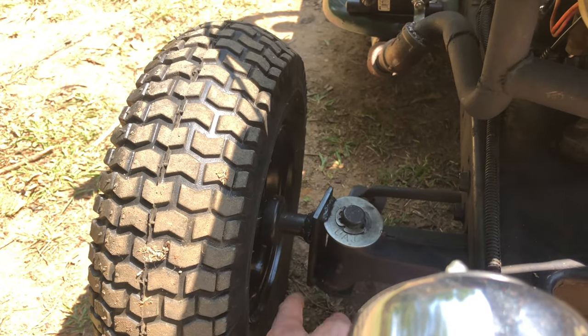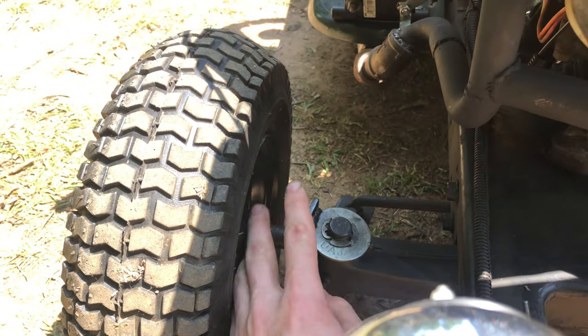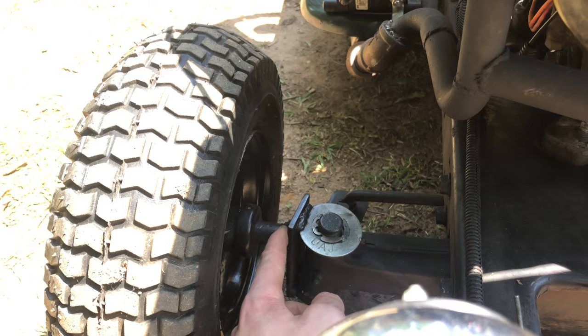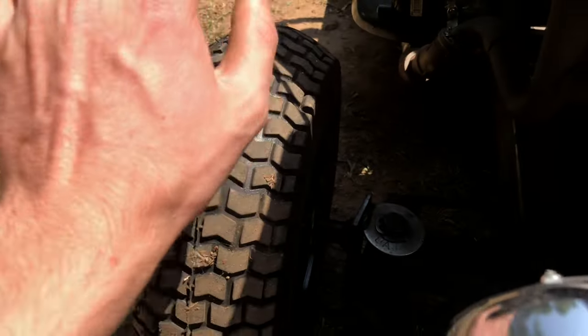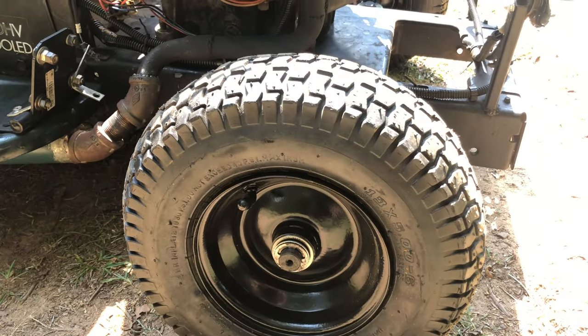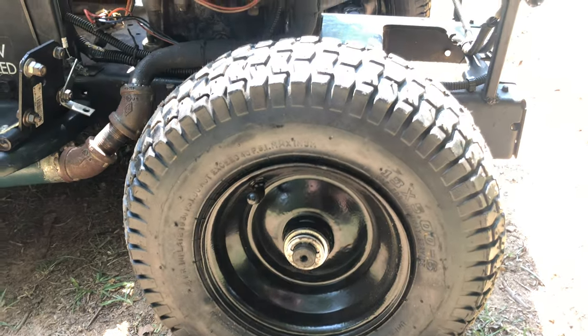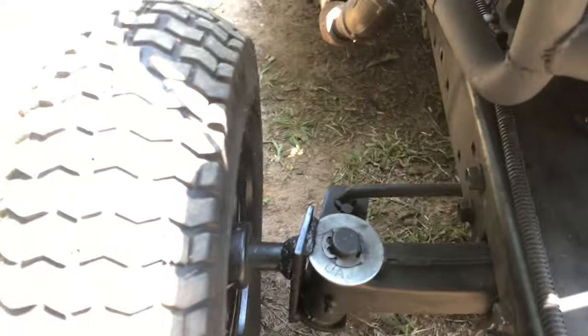To lower it, I chopped the spindle off, put some washers, welded on flat bar, and then welded the spindle directly on — just like Cars and Cameras did — and bolted the wheel on. These are not the original wheels; these are 13 by 5 by 6. The original tires are like $80 a piece, which is outrageous, so I'm not paying that.